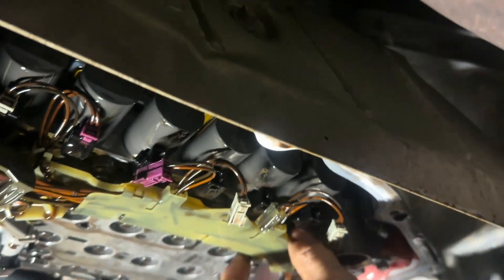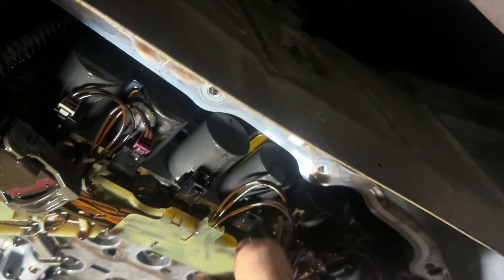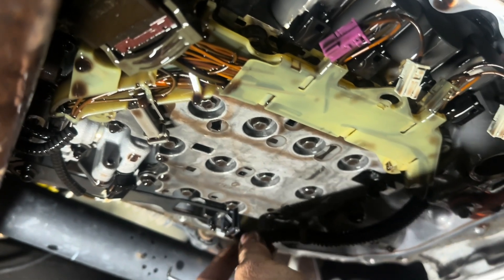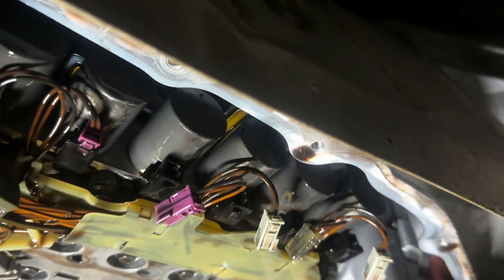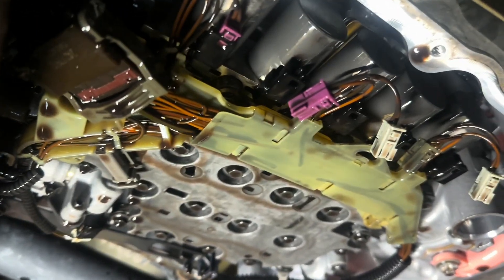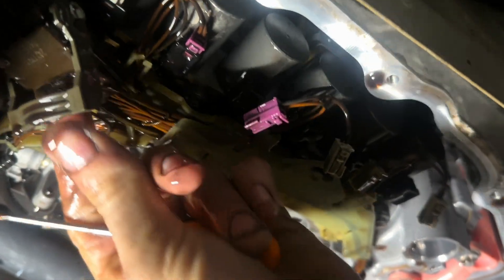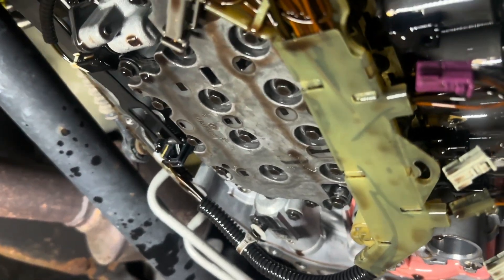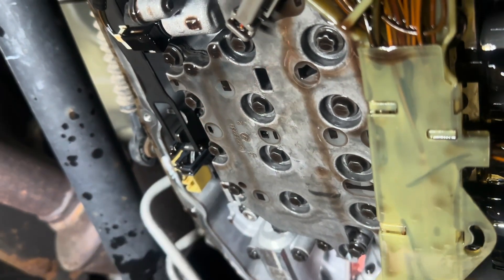This is the harness we're replacing because it has a little temperature sensor built right in it, and that's what's faulty on this one — it just had too much fluctuation. You go on and unplug everything that attaches to this, hook it over here and plug it there, go around and get everything unplugged. Get that unhooked, get all this pulled down — these squeeze inwards, and that's how you get those out to get that harness down. There should be another one over here. This one here is like a BMW-style, it flips up to get that harness loose. I like to show you all anything that's different — this connector has a tab you pull down on and then you can squeeze the tab to unplug it.